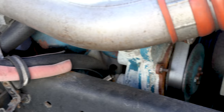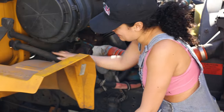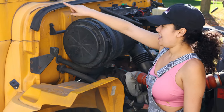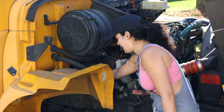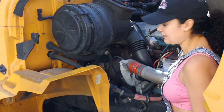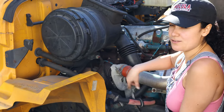Where our coolant starts, there's a line that runs underneath all of this stuff and it ends up right here. It flows into the bus where then it goes through all three heaters, and then it comes back out into the bus. It flows through here where it eventually ends up in this coolant line, and this coolant line goes into the engine. So basically what we're going to be doing today is cutting the coolant lines here and here and connecting them so they just flow into themselves.